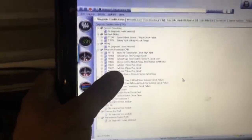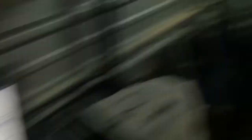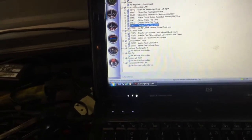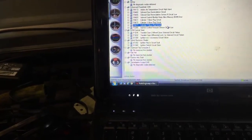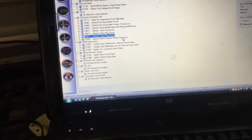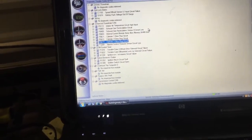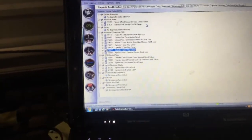The codes we've got: air intake temperature — that's because the intake is off the truck, no air filter. Glow plugs 1, 3, and 7 — it's a good thing those are all on one side. And ICP control pressure sensor low (P2285), which means when it's cranking for over 20 seconds and it doesn't see ICP pressure at 500 pounds, it throws that code.